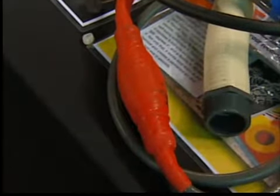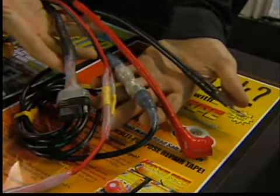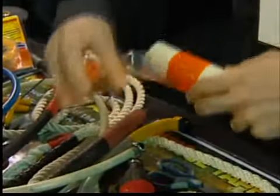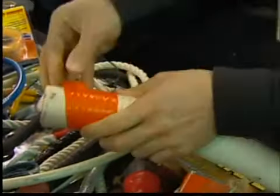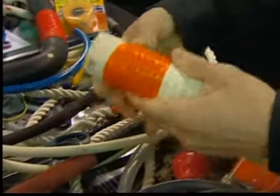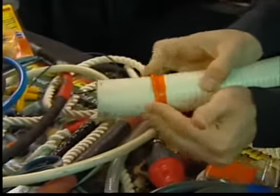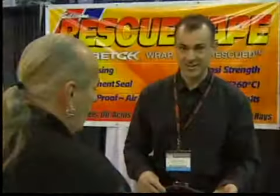Wow. I can see so many uses for this. Like a lot of this is electrical, so we get a wire that breaks or something and we can splice it back together. This is so tight that it can hold it and get you home. Absolutely, Steve. It's actually insulating to 8,000 volts per layer, and it's waterproof, so it keeps the road salt and rain out of your connections. It's like a silicone shield over your wires to protect it.